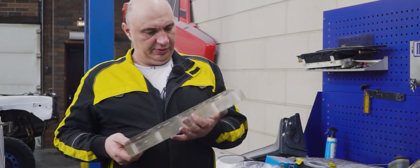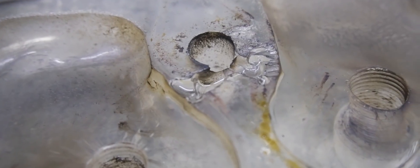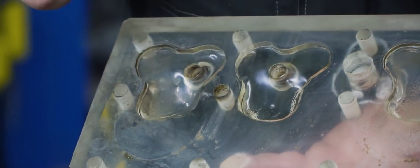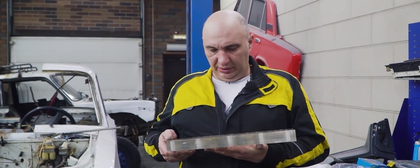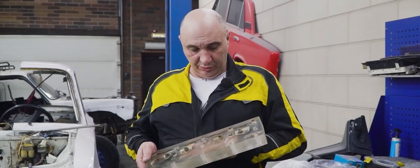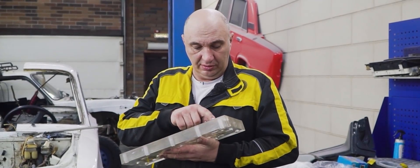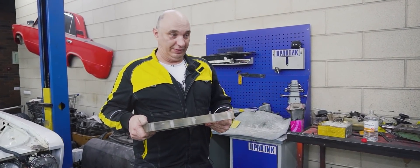Here's the situation — I do not like what I'm seeing here. Here's the reason it was running so poorly: see how this is melted? It kept trying to burn through to the nearest bolt, and there's clear evidence of it in multiple spots. We really need to rectify all of this. I guess we start by giving it a once-over on the milling machine to get an even surface, and from there use the same method I did for the crack — fill the defects with resin. Let's rebuild the head and reinstall it.